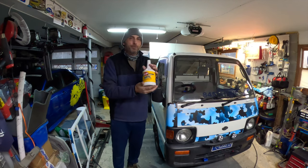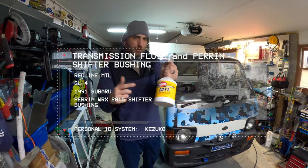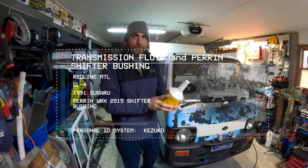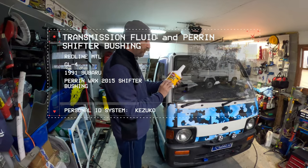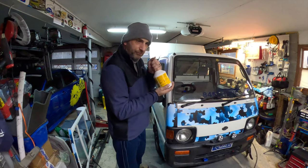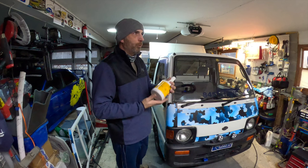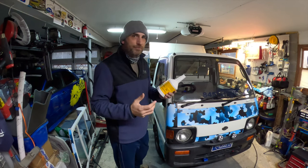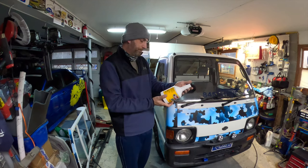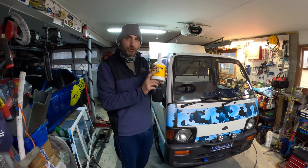I think this is going to be the actual proper juice to go inside of this TY60 transmission for the Clover 4. Now this being GL4 and being the 75-80, this flows a little more liquid in its flow, whereas 75-90 is very thick stuff — like molasses, like syrup almost. The only reason we were using MT90 is because it's readily available; this stuff is not.